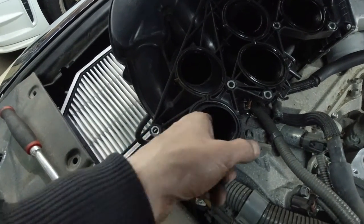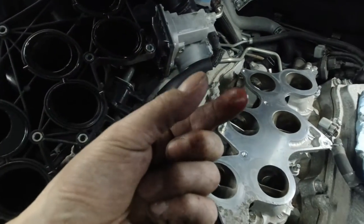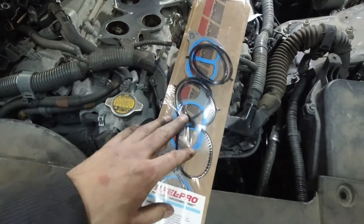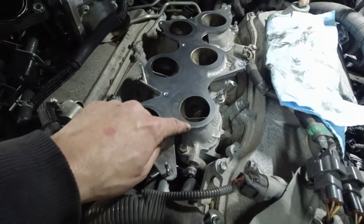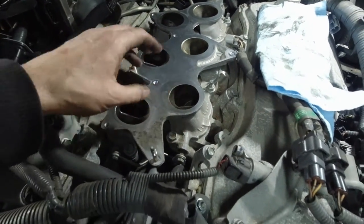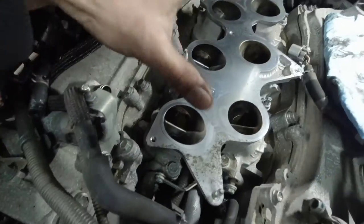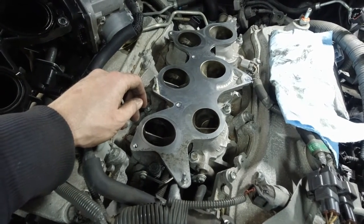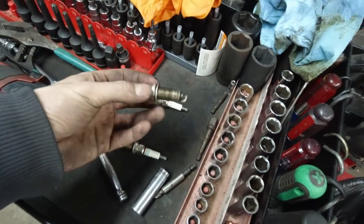This carbon buildup is soft. There's still a lot of oil everywhere. When you're doing the spark plugs, get yourself intake manifold gaskets as well. The black rubber ones go here and the blue ones go right underneath the upper intake - or the lower intake, I should say. This car has 101,000 miles on it and has trouble starting when cold. I'm not replacing the intake, there are no air leaks - I am just doing the rubber gaskets and the spark plugs.